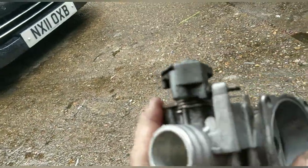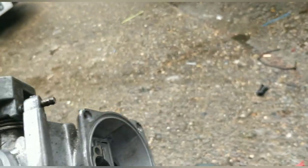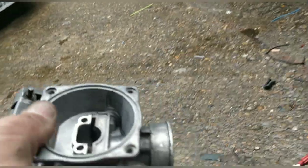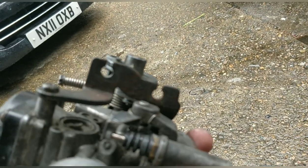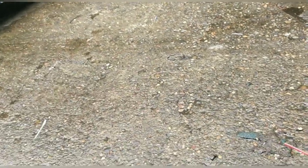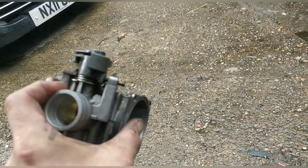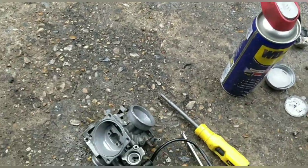Another reason this off-the-shelf working carb is junk: the idle screw was seized and now it's snapped. Hopefully the idle is okay. I've cleaned this one now. If I find it's hugely bad, I may have to switch all of this back over to the original carb. But there are bits in here that aren't right either. I don't think I'd be able to make one good carb from them. There's no easy way of fixing a snapped screw — you can't really drill it out. It's a pain to drill through bolts. So I'm going to keep putting it back together in hope that it is good.